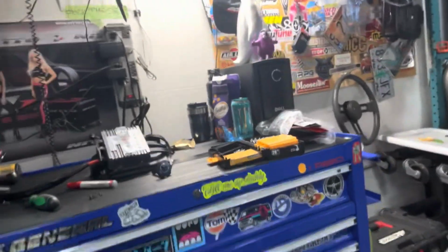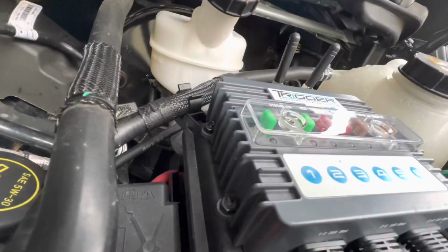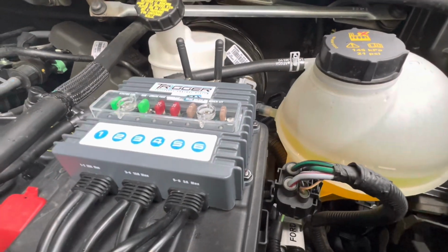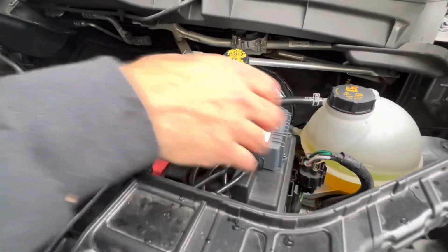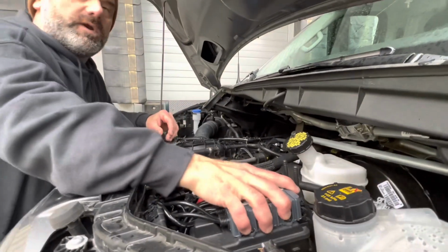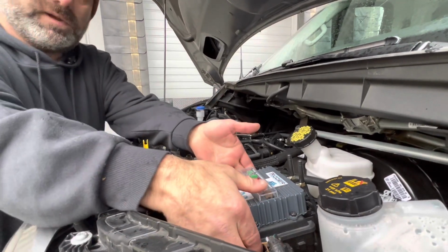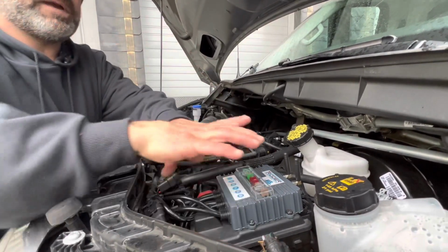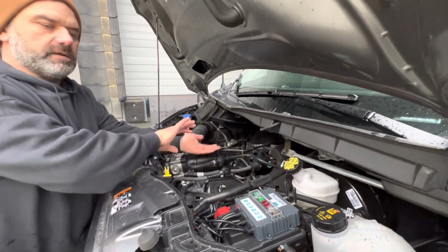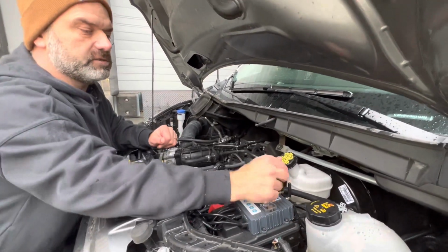Very clean. Again, it's all in the details. You'll notice that we actually use some little mounting screws on each side. I have seen some people use 3M double stick adhesive tape, Velcro, etc. Again, we pulled the cover off, we drilled through, and we used some mounting hardware because I wanted this to become a fixed permanent piece. I also wanted to know that if I need to remove my cover and access the fuses for the vehicle or any of the relays, this unit can come off very cleanly with it and be reinstalled. The other thing you'll notice, it has the two little antennas.